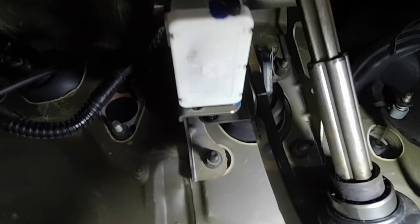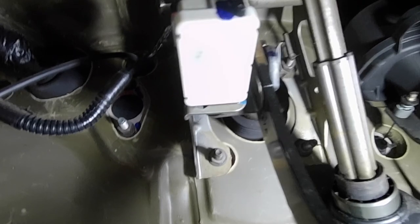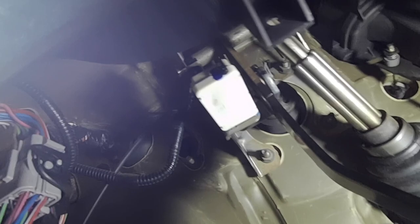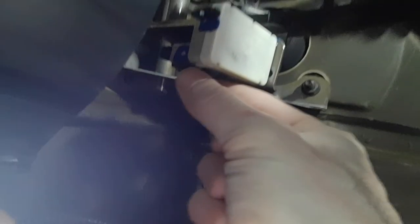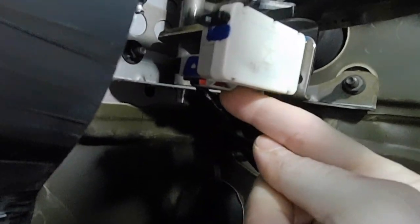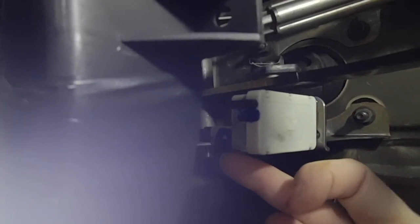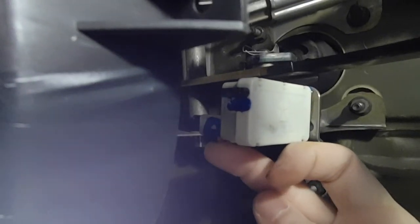When you press the pedal down, there's just a little tab when you release the pedal that presses that button back up and shuts your brake lights back off. We'll get the wire disconnected first. There is a safety tab on it, a retaining tab, and you can see that right here. I pressed and got the first stage of the tab by pressing on the end of it. Then hook your fingernail or a flat blade screwdriver works, and you can get it to rest — I believe that's released.